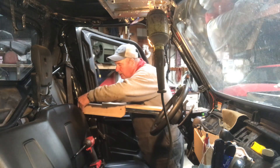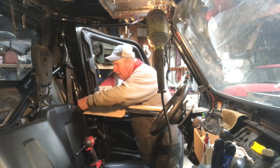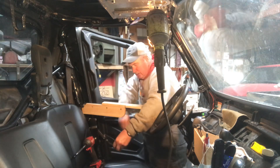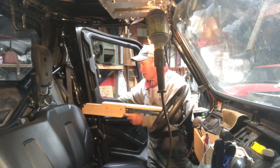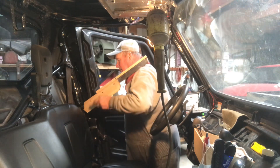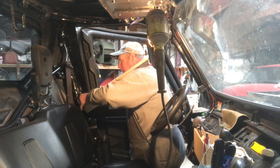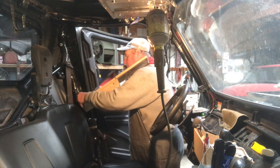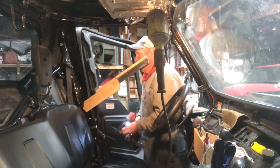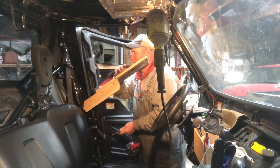I'll put a nut and a washer on there — I don't have this thing painted up yet. I was getting ready to paint it but I thought I'd show it to you first. Get that nut started on there — just takes a seven-sixteenths. Then I'm going to raise this up on my shoulder to give me room, stick my gun on the outside, and draw that up snug. You see how everything levels up — the nut and the washer back there spaces it up.